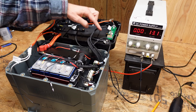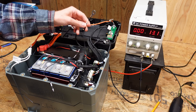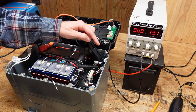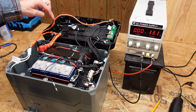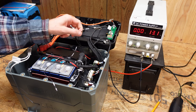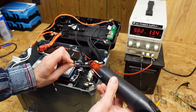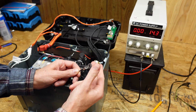I also want to verify the terminal post sensors are working. After exchanging emails with the company, there are actually six temperature sensors in this battery, though only four are visible in the app. The two on the battery cells, one on the MOSFET transistors, and one environmental sensor on the BMS are the four visible ones. Sensors five and six are on the two posts. Pulling the sensor off the negative post and heating it stops charging — confirming the post sensors are fully functional.